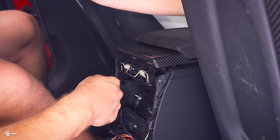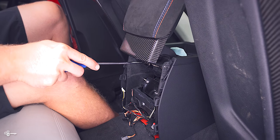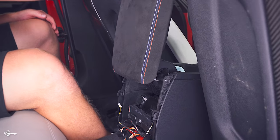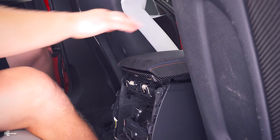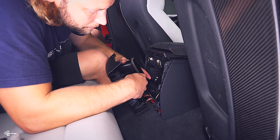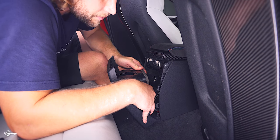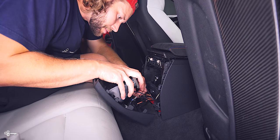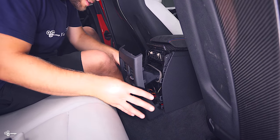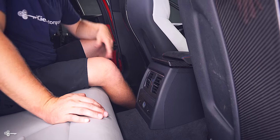Before I put the spring, I'm just going to test it out, make sure everything's good. Then you can take your screwdriver here — I like to release the tension, that's why I'm pushing it in — and then that's going to snap into place. We have a fully functioning armrest. So let's plug this back in and check out how good it looks. This goes here, and then we have heated seat number one, heated seat number two, and then we have our 12 volt. Then we can just take this, line it up, pop it back on, and we are done.